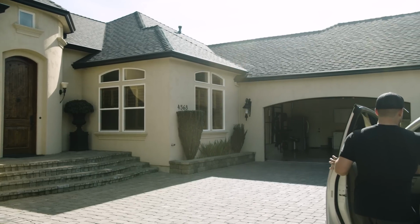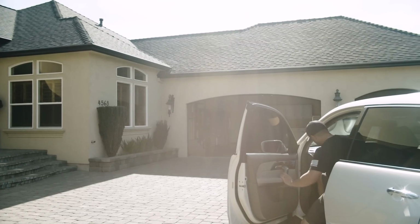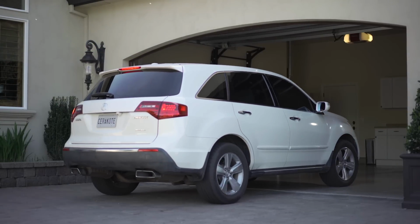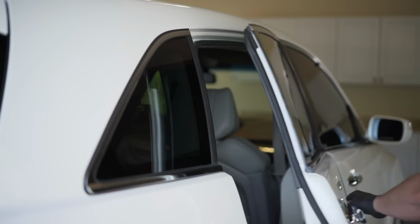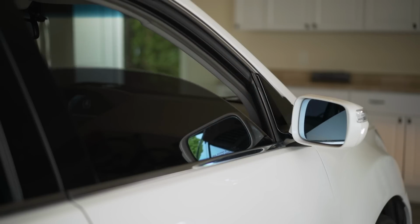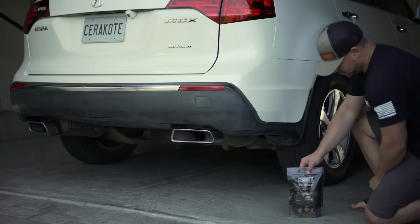After washing and completely drying the vehicle like we just talked about, move to a shady spot out of direct sunlight in a well-ventilated area. Working in shade keeps the plastics cool and extends the working time of the Trim Coat. Leave doors, hood, and hatches open at this point, as well as windows down. This will allow best access to all areas that will be coated.